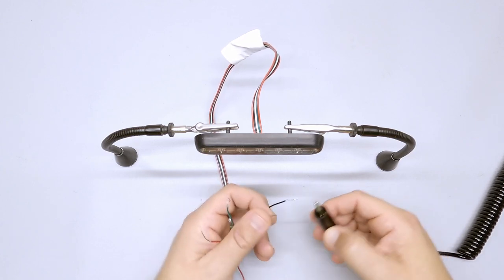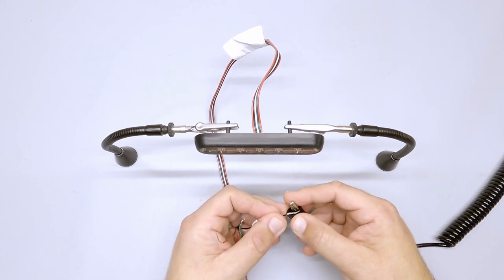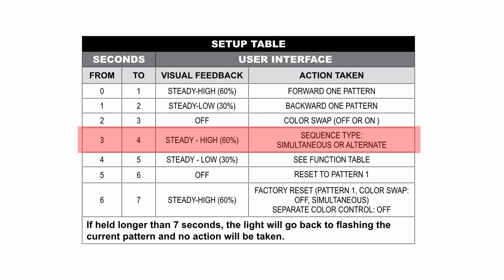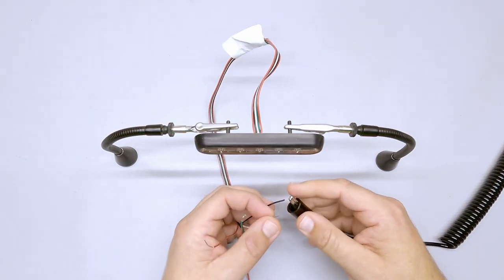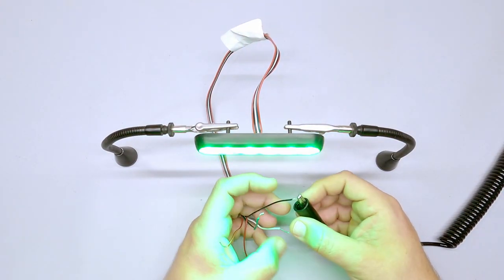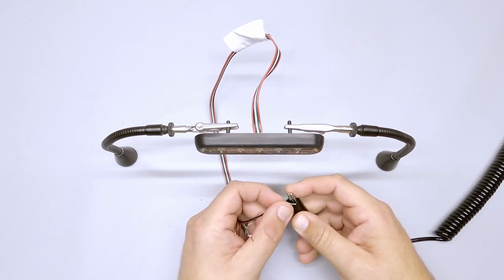The fourth function is called simultaneous or alternate — for Blueprint users, this is best described as Phase A and Phase B. By default when I give this thing power, it turns on immediately. The next programming function is more than three seconds but less than four seconds. You'll see the feedback: high, low, off, then back to high. Now we've set this light to work as the alternate phase, so when powered, there's a gap — if we had two lights synchronized, one goes first, then this would be the second in the sequence.